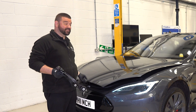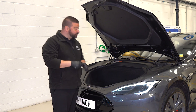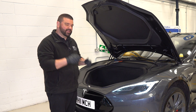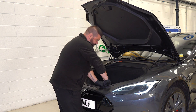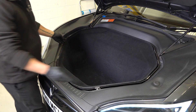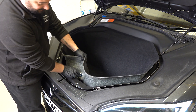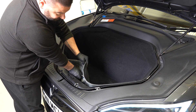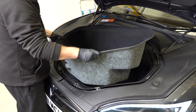The first step is to lift what Tesla call the frunk since there's no engine on there, and we need to remove all of the interior components here from the frunk. We can remove the frunk cover — just have to disconnect the lighting here and there is also a second electrical connector underneath for the emergency release switch for the frunk.